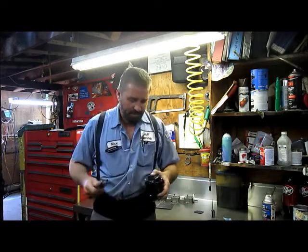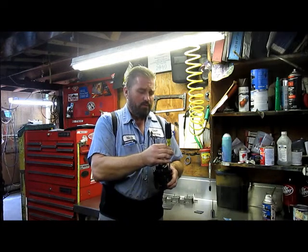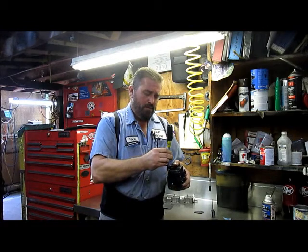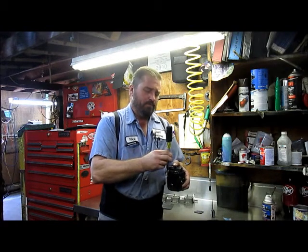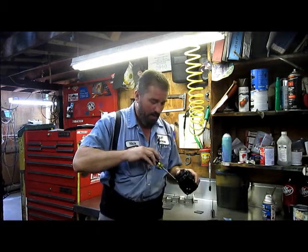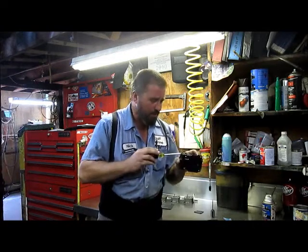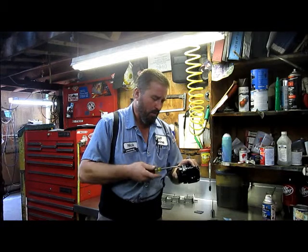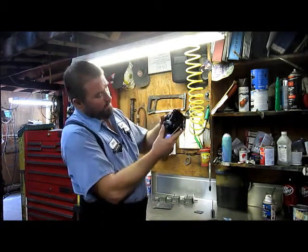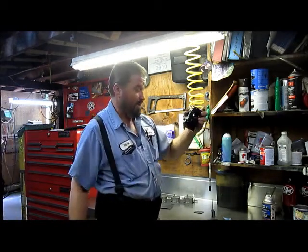With these plastic bodies — and with most mechanics — always turn the screw backwards and you'll feel it drop in. Turn it counter-clockwise and it'll drop into place. That'll keep you from stripping the threads out in this body. It's very important that you do that — it's actually in the service manual too. Turn it backwards, feel it drop into position, then proceed with your clockwise motion to tighten it up. You want it not too tight and not too loose — but not so tight that fluid can't get in and out of it.